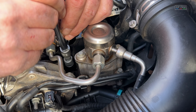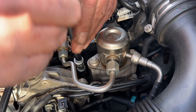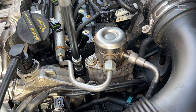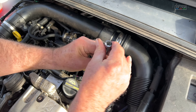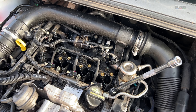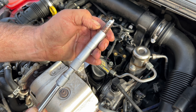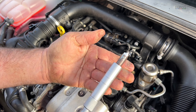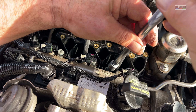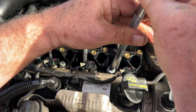Because these are so easy to do — they're on top of the engine — I'd use the plug wrench. If they were difficult to put in I would use a rubber sleeve to feed it in, turn it, and get the thread. But on this engine they're vertical. Don't forget we've checked the gap, which is 0.7 of a millimeter. Very gently — you don't want to drop the spark plug. Just want to get the thread at the moment. She's caught — I just do it by hand until it goes fairly tight.